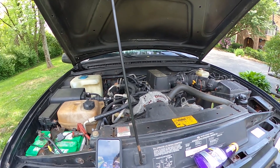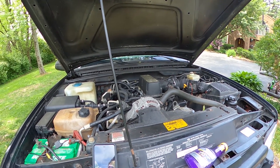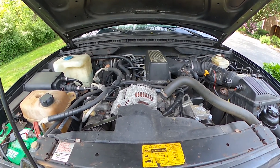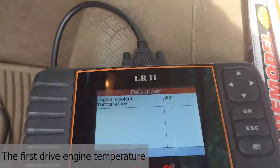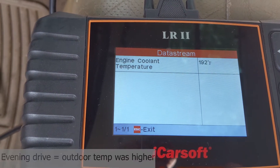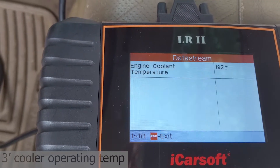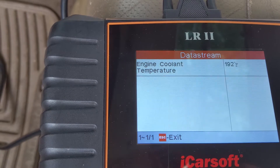So I'm going to drive the vehicle and determine if it's keeping it cooler. I took a baseline reading with my iCarSoft using the OBD2 port, and I'll stream that data once I pick up my son and come back home later today. Okay, so I just did the same long drive I did this morning, but it's significantly warmer — probably 15 to 18 degrees Fahrenheit warmer. And it's operating at 192 degrees Fahrenheit. I believe before it was 195–196. So on the identical drive, now warmer and sunnier, it is operating at a lower temperature with the Purple Ice in the coolant.